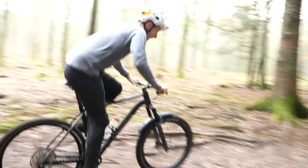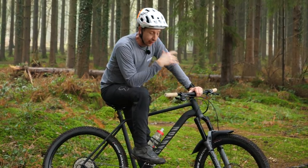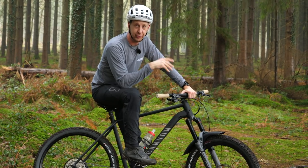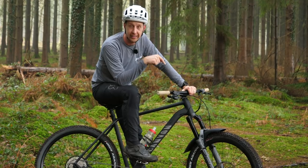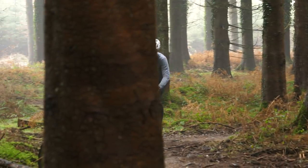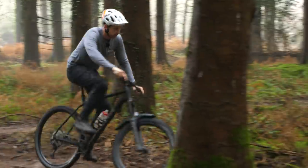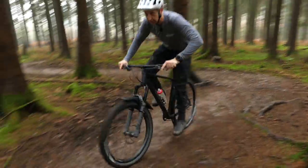Monster, this is. All right, so there's already a few things going on with the bike. Now, the first immediate thing is how agile the front end feels. So the head angle is 3 degrees slacker, and the fork is heavier. But the lighter wheel, with the gyroscopic effects you get between the differences in a bigger wheel and a smaller wheel, just feels so much more agile, even though arguably the steering is under more control.